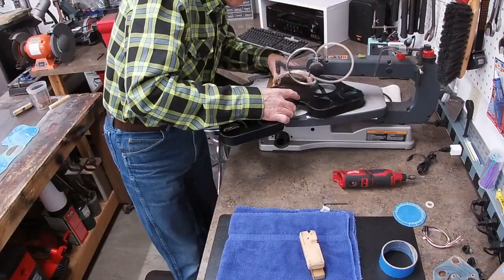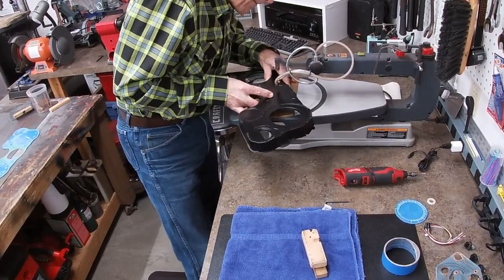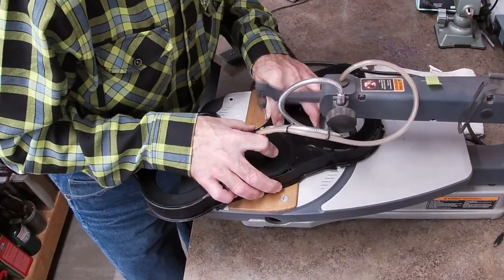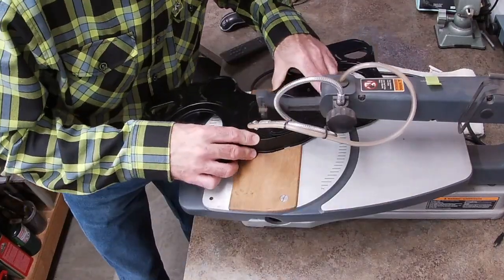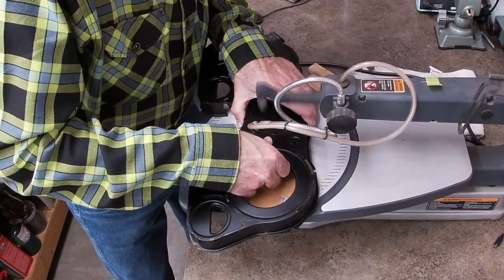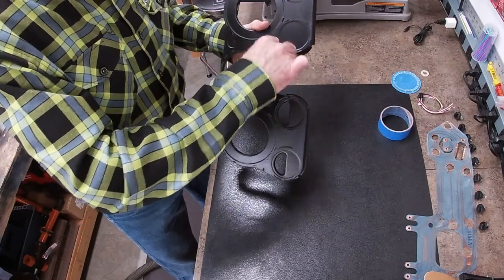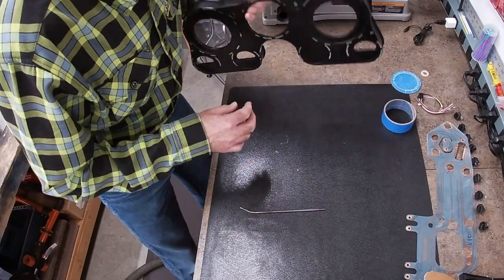in this panel. So when cutting through the sheet metal, I've actually increased the speed of the blade quite a bit on this. It still takes just as long to go around, but I've increased the speed to give myself a cleaner cut, and the metal tends to jump around if you go too slow anyway. I don't know why I didn't explain in here why I'm doing this, but it should be quite obvious. I'm deburring the metal so it doesn't scratch as it goes through, just to smooth out the opening in there.